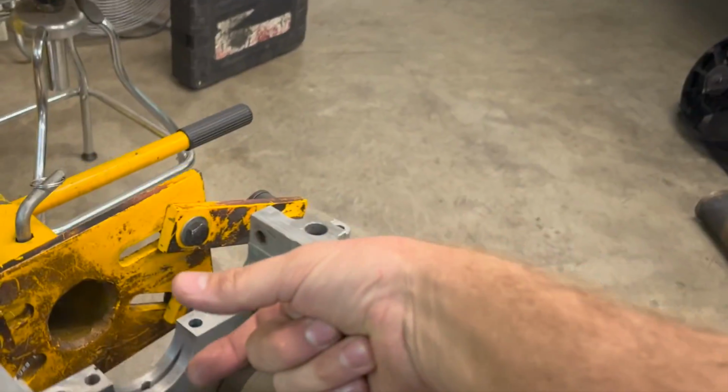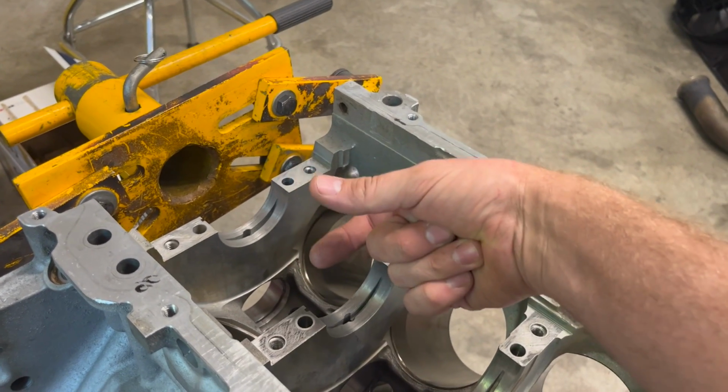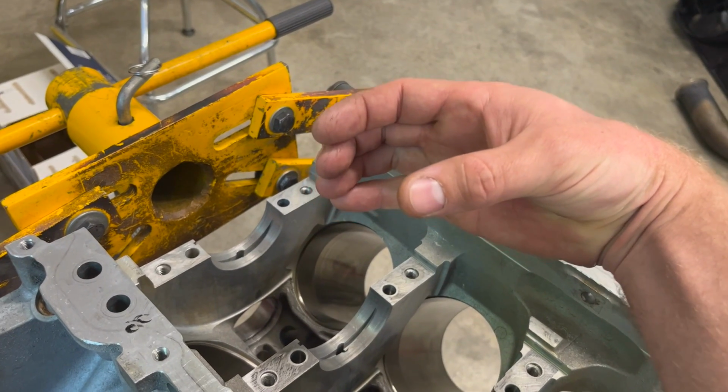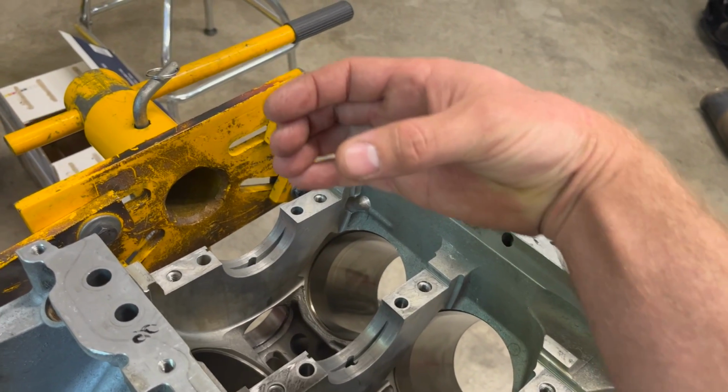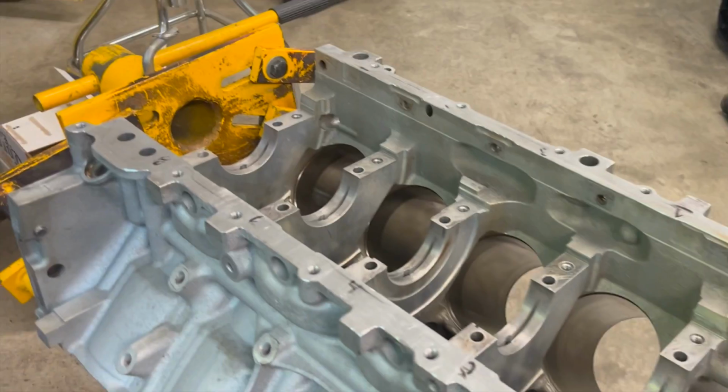I screwed up number 5 because I put the bearing too close to the collet. So when I was hitting it in, it was just bouncing off of the metal. It should be in a rubber encapsulation bushing, basically, so when you're pushing that thing in, it's never hitting metal. It's just rubber bearing block. So I screwed 5 up.